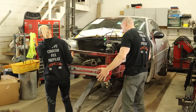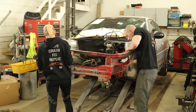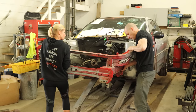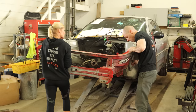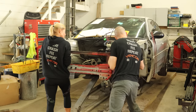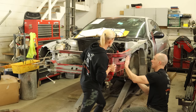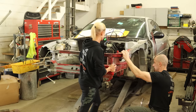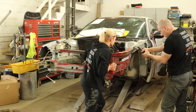The upper tie bar fits over the other piece because it fits down inside. Our lower frame rail on the driver's side slides right over. And the upper frame rail we're going to sandwich in between. So we have our scraper in there — we'll pry the apron over and kind of force it in there. We'll tap our lower frame rail up into place.